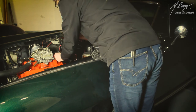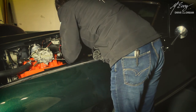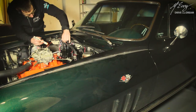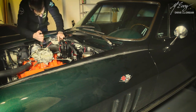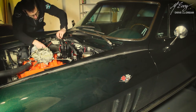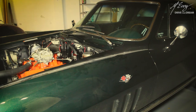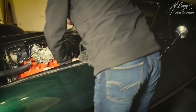Okay, so it doesn't just fire up like that and give you 500 extra horsepower. Step 1. Check for power at the coil. Don't forget to turn the ignition on, you goof. Just to make sure, take the input lead off the distributor cap, place it close to the solid ground and crank away. If you see a beautiful blue spark, you're good to go. If you feel like you've just been hit by a train, that was 45,000 volts. In both cases, we have ignition.